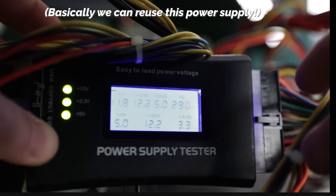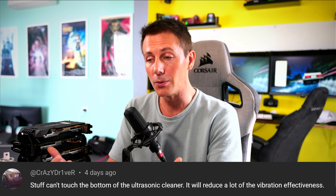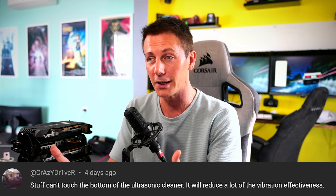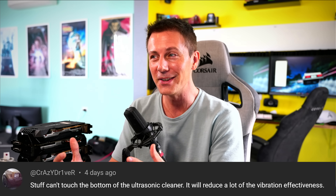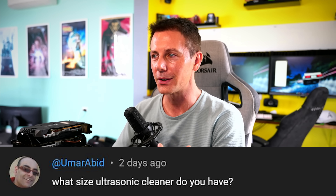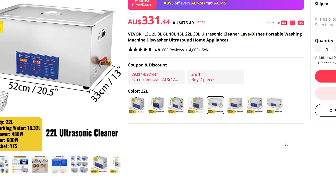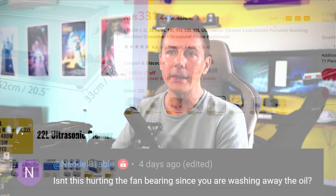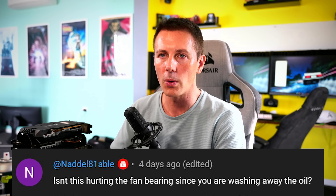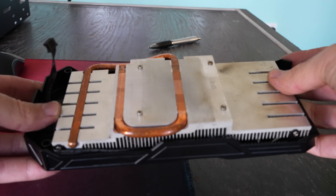Next: stuff can't touch the bottom of the ultrasonic cleaner because the vibration won't be as effective. I do agree here - you do want to use the tray if possible. It's just in this case I wanted to get all seven cards done in one go and it just fit without the tray. So usually you should use the tray, especially if you can. In terms of what size ultrasonic cleaner we're using, I'll put that up on the screen - if you want to use the one I use, I'll leave a link in the description below. Then the next question: isn't this hurting the fan bearing since you are washing away the oil? If oil is coming off the fan when we're washing it, we are re-lubricating it with the multi-purpose spray, so we covered that one.